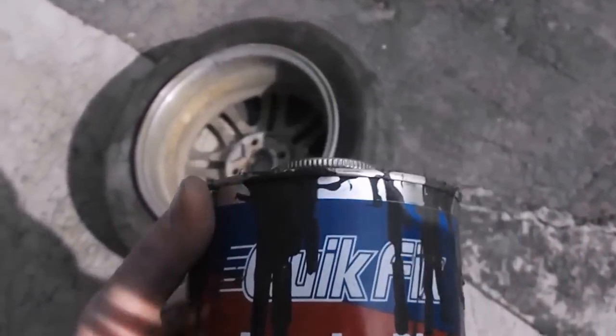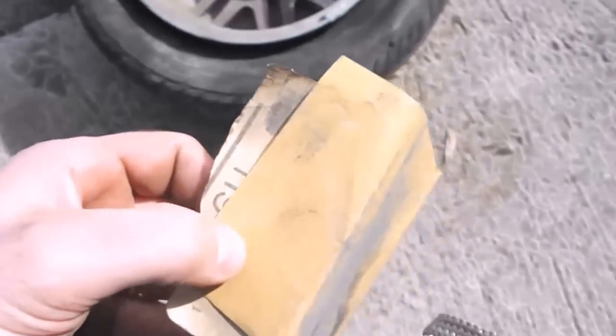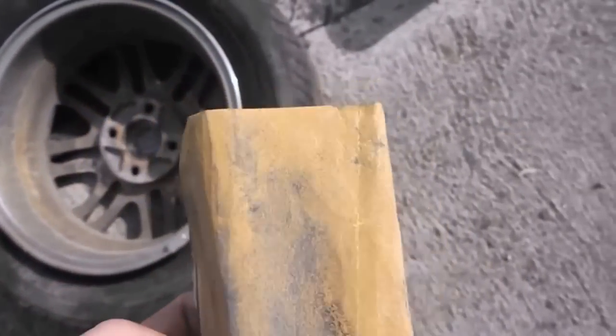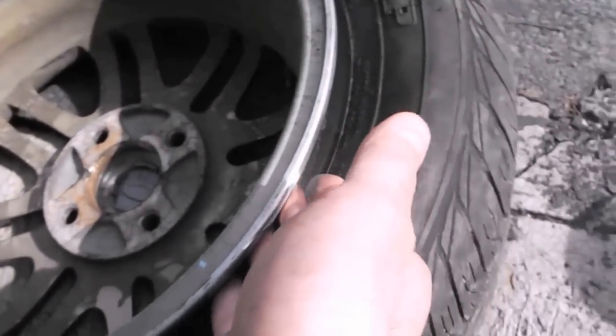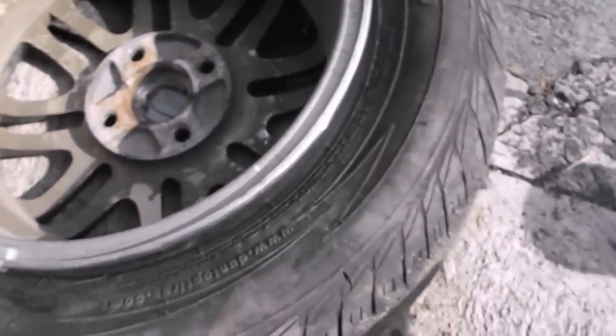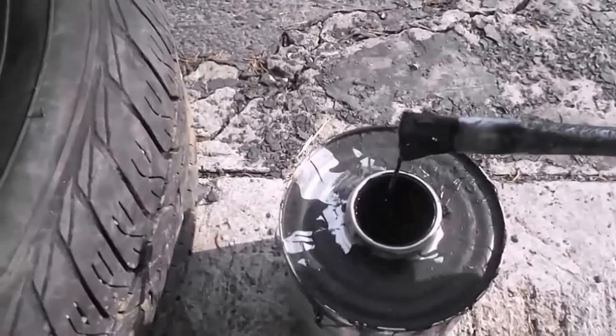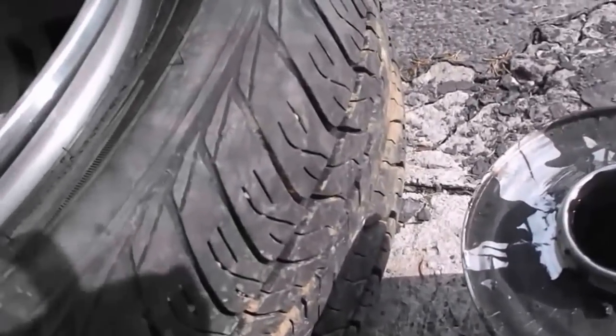What I did was I had the bead broken down already, and I took some sandpaper — emery cloth is even a bit better — and went around the inside of the rim. It helps when someone else presses the tire down with their foot so you get some room to work. Now I'm going to apply some of this product around the rim and see if that will take care of my minor bead leak.